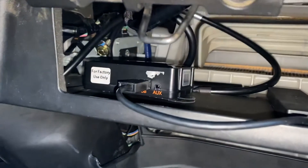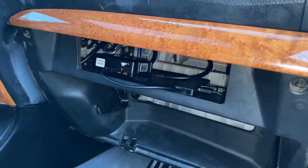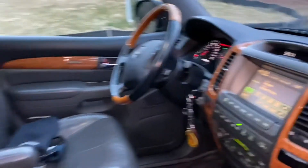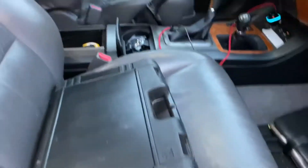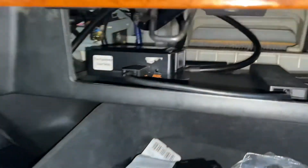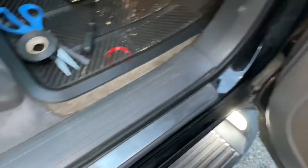In the old CD tray, we have the Bluetooth radio module and the wires for the dashcams all bundled and taped up to keep them secure. I'm going to put the glove box and bottom tray back on and show you the final results. I'm all done with setup. You can see my phone on the screen — 'Michael's iPhone' — because the Bluetooth module is active. Looking at the glove box, the Bluetooth module is mounted where the CD changer was, along with the dashcam wires. The front dashcam wire goes up, out, and down into the glove box, and the other runs underneath through to the back door where the camera is recording. Thank you for watching — I hope to post more good content soon.